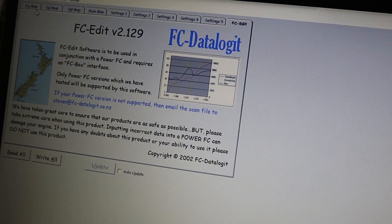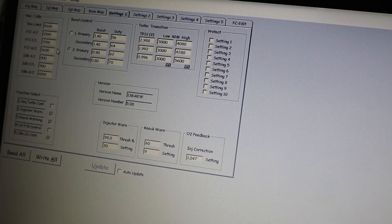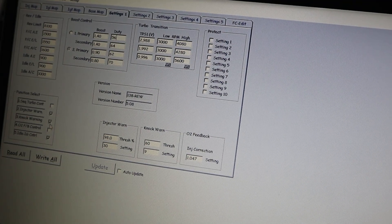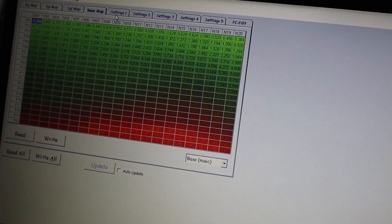I'm going to open up his map. Now that we have Jason's map loaded, I'm just going to run through and take a look at some of these settings. As you can see, a lot of things are different. His first boost option was 1.4 bar, which is crazy — so this is the duty cycle for 1.4 bar on both turbos, set here for a twin turbo setup. Sequential turbo control is off, injector warning is on, knock warning is on. The knock sensors in the car standard go haywire — they're always flickering. Essentially there's a little light on the dashboard: your heater light flashes like crazy and that's now your knock light. So I've personally gone through this map and I'm pretty happy with it.